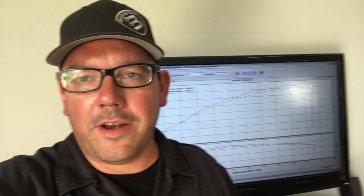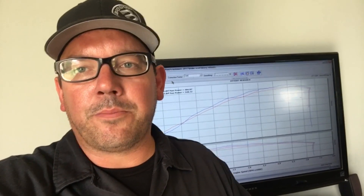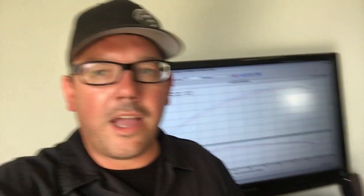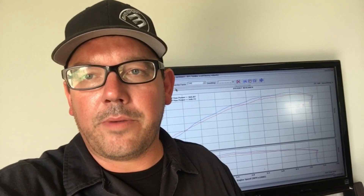So what do you think about that? I weighed the wheels — we had about 17 pounds each where the 20s were heavier, total 34 pounds. And what that meant was about a 5% loss in power on the dyno running the 20s versus a factory-style 18-inch wheel. I think that holds pretty true — 5% — because there's been a lot of cars I've tested this on, mostly higher-powered cars making like 630, and then we put a 20 on it and it might make 595, 600. So about 5% loss. So if you have a heavy wheel on your car and you go out and get a dyno, you can expect to see a little bit better number on a day that you have a stock wheel. 5% is kind of the rule of thumb, but some cars might be a little more, some a little less — depends on the weight difference of the wheels and tires. We're only talking 34 pounds — pretty significant difference across the board on the dyno.